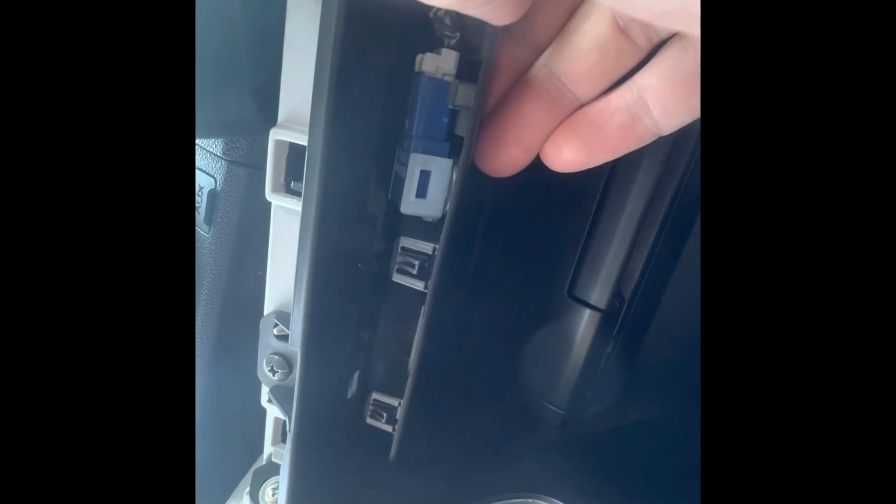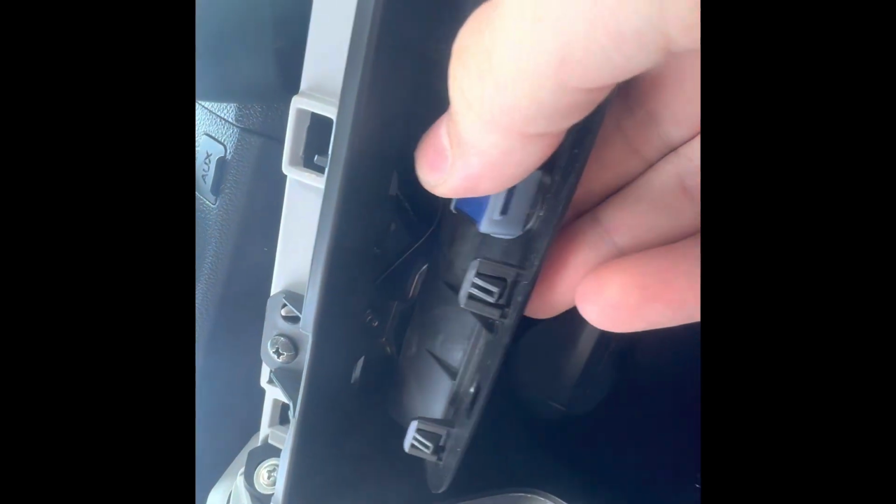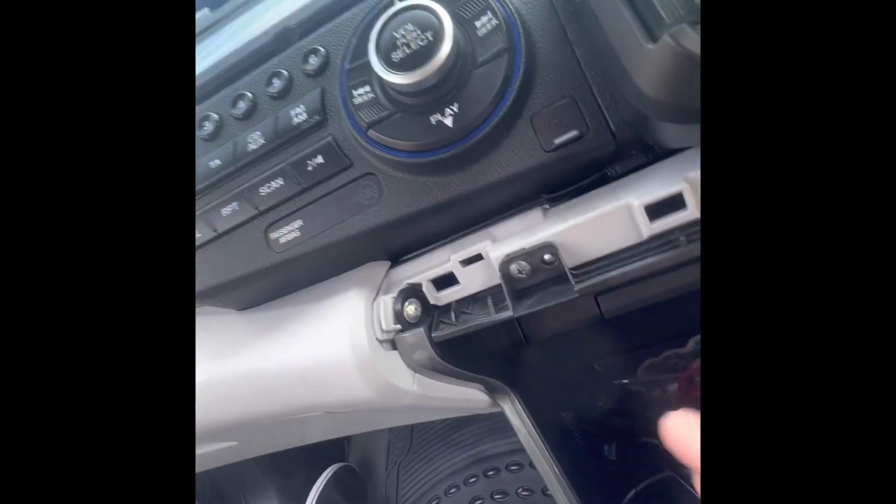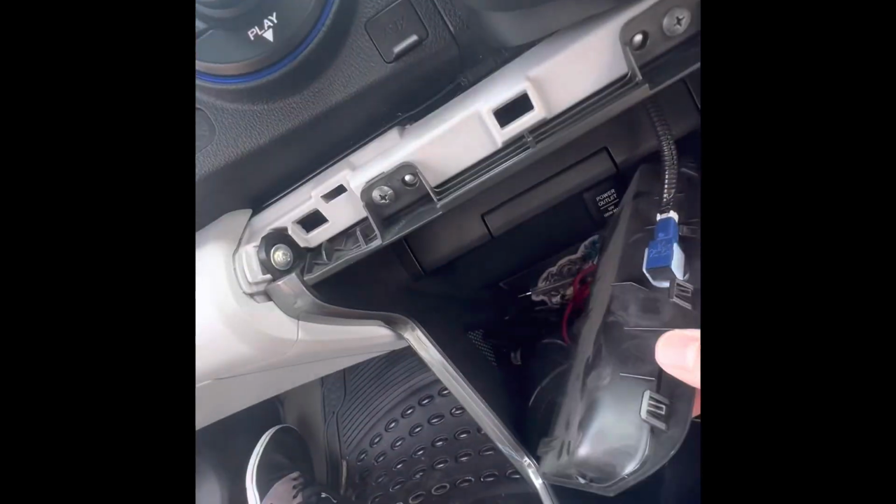At the bottom in here, if you can see, there are 2 little holes, and this bit of plastic moves on its own. You can literally just untag this, and with this tiny cable attached to it, this literally just comes out. And as soon as this is out, just be gentle with it. I also don't recommend doing any of these jobs in really cold weather, because all this plastic becomes brittle and it's so much easier to break all these pegs.